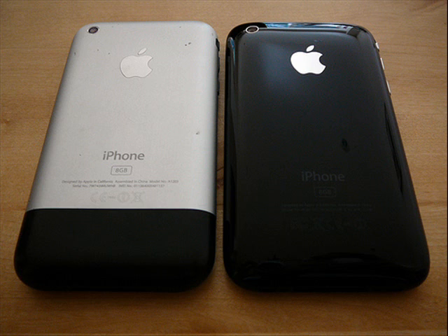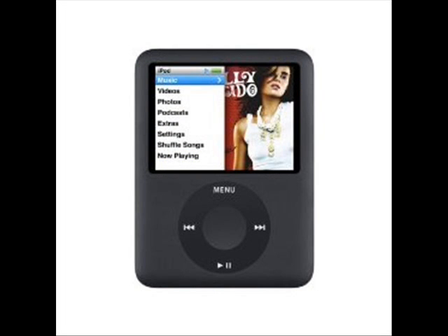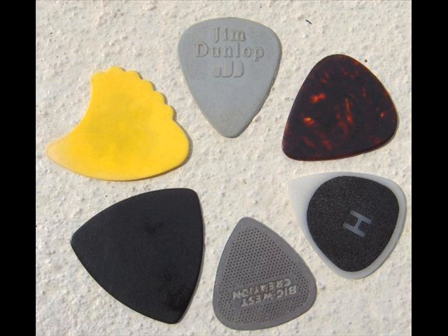If you're trying to open the iPhone or iPod Touch, this one opens with screws. There are a lot of tutorials on how to open these — basically labeled how to replace an iPhone or iPod Touch screen — that'll show you how to open up the device and get to the logic board, which is where you have to get the water out. For the iPod Nano, it's similar to the iPod Classic. You open the area between the seams, between the chrome backing and the top part where the click wheel is. Use either the tools provided or a guitar pick — it's a little more difficult with the Nano, more tight, but you should be able to get it.